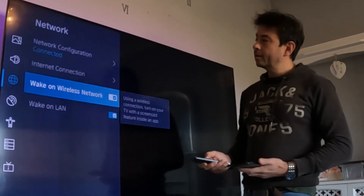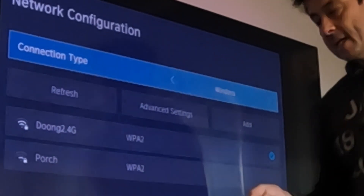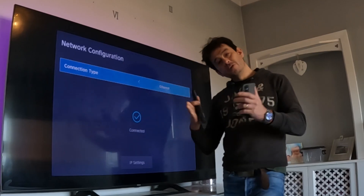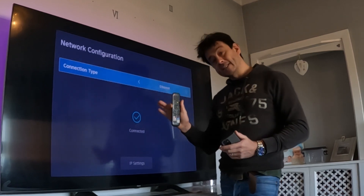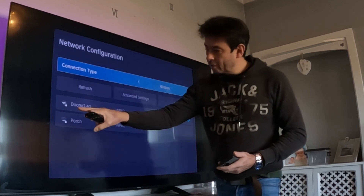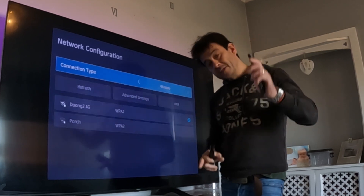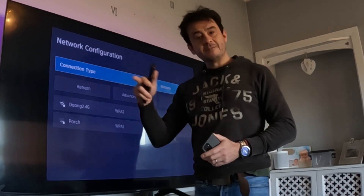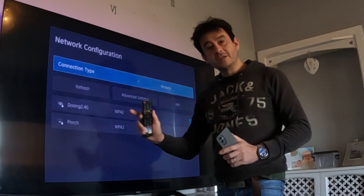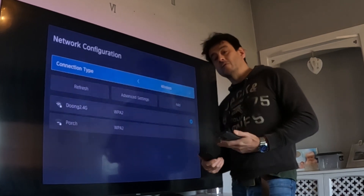Here's network. Now the network connection I've got - I've got wireless and I've also got Ethernet. It doesn't matter whether you have it hard cable or using wireless, the router is all working from the same thing, but you've got to make sure that it is connected through the same network. If you've got wireless, you want to make sure that the wireless name for your house is the same as what's on your phone. Sometimes if you've got the 2.4G and the 5G it can get a little bit confused. So if you've got 2.4G on your TV then put 2.4G on your mobile device or laptop, and then see if the two can talk to one another.